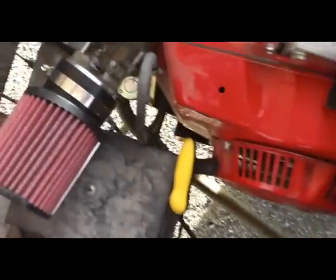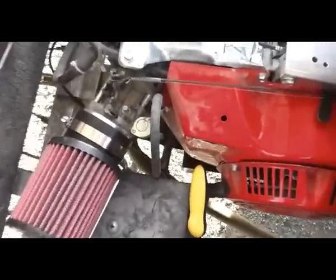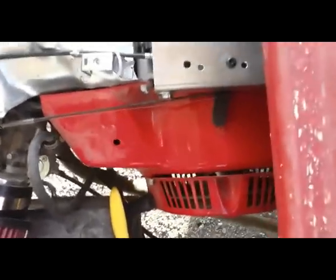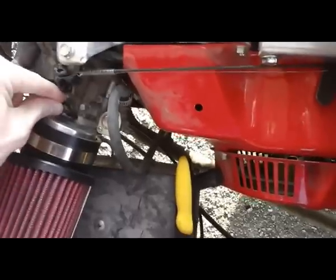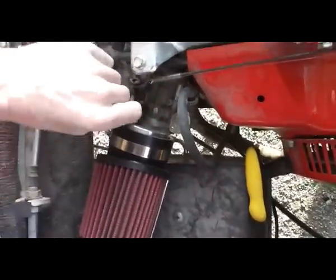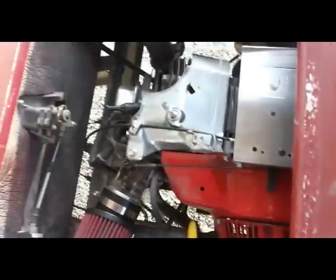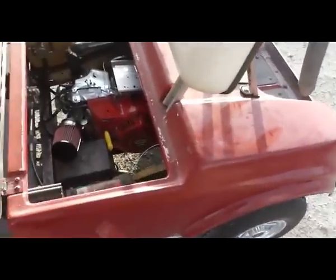This is the final setup. My filter didn't come with a choke lever hold, so the lever came off, and I can still use the choke this way even though it's kind of annoying. But I am able to start it cold without choke now that the governor is removed, so no need to open the thing every single time I want to start it.